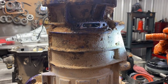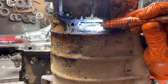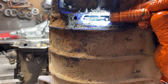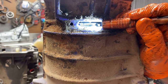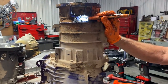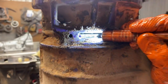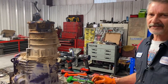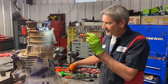Did you see how far that fell? Kind of splashed on you just a little. See how far that fell below that snap ring right there - that's the clearance you have from that snap ring down to the top of that overdrive piston. If we would have our end clearance set right on the front part of the tranny - the three-speed part of it - that bearing would have only fallen about twenty-five to thirty thousandths. We try to set them up on the tight side a little bit. I think you can go all the way up to like sixty-five or seventy thousandths on the play or the clearance. But you can take and pick this back up and put that right back in there.